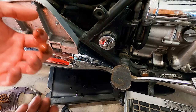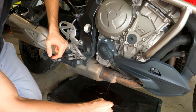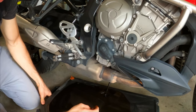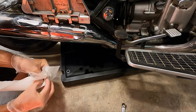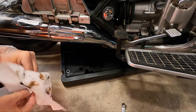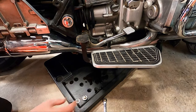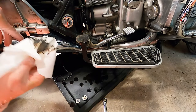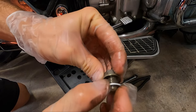So we're going to have to put it on the kickstand. Oil looks really good — no discoloration, no fogginess, anything like that. That's a good sign; you can tell a lot about an engine based on how the oil looks. A good rule of thumb when you're doing drain plugs: you have a crush washer on there, so you basically just tighten it until it stops and then just one little bit at the end — that's usually perfect. Got a new crush washer.